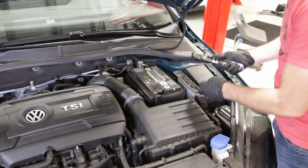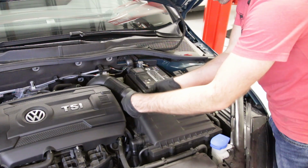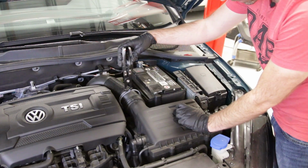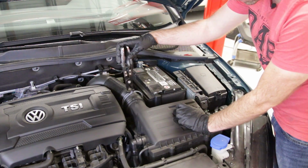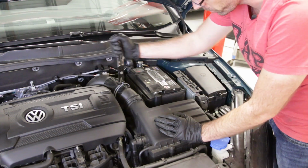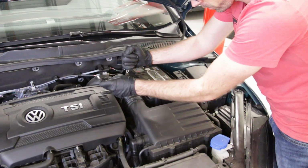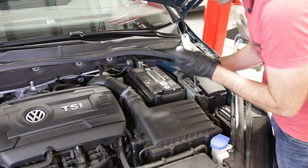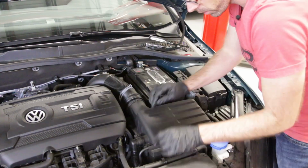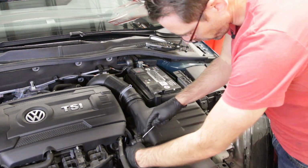All right, we're going to start by taking our air box out of our vehicle, and we have our hose clamp pliers. You don't need these, but these are extremely nice because you can do that and just lock that in place. If you're using regular pliers with these, you will slip off a bunch and it will be a painful experience. So I'm going to put this right over here for now, and then we can slide our hose off there.